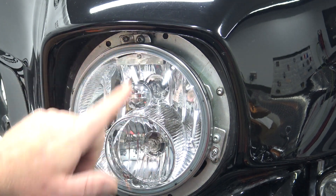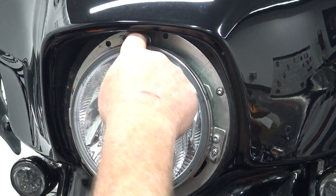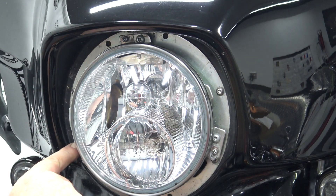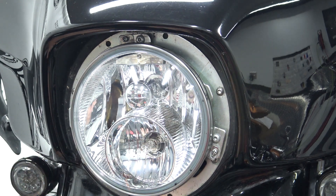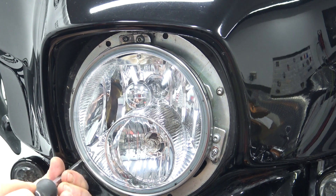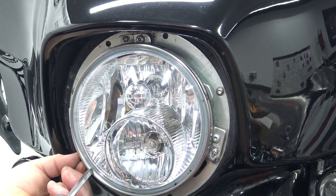Follow the ring — you've got a Phillips head screw here, one here, and one at the top. The torx head screws you see here will adjust the up and down and left and right of the light, and the torx head screws all the way in the back are for the actual headlight frame itself. So don't take those out — just take the three Phillips screws out to remove the ring. We will reuse these.